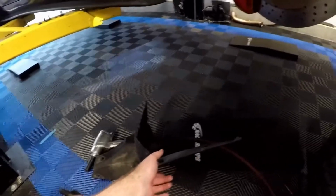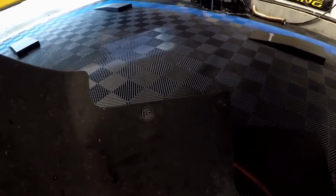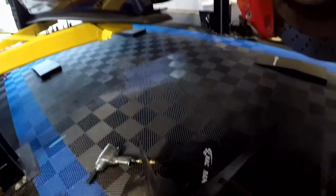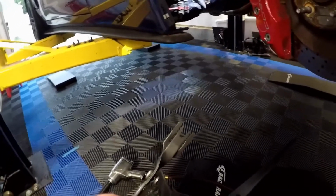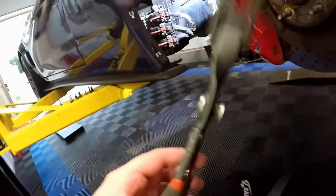And then on the bottom of the inner fender well of the trim piece, there are these 2 holes right here. Those had some push tabs in them. Use your push tab removal tool. I'll have a link to this in the description below as well. These are very helpful for taking cars apart.